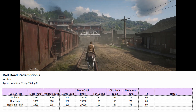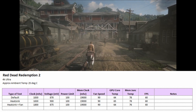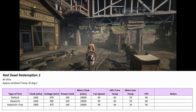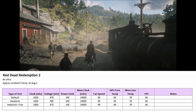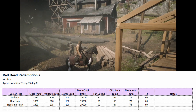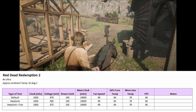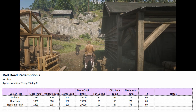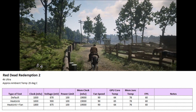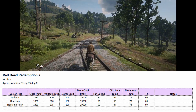For mining, I would say if you can find a faster fan higher than 2000 RPM, a better heat sink — maybe copper — and can possibly remove another 2 to 4 degrees, then that would start to look like a good solution. There's also the option of changing out the factory thermal pads and thermal paste, but ultimately it's up to you if you want to open up your card, which may or may not ruin your warranty depending on which country you purchased the card in. The results of doing that have also been varied — it's not always a given that changing them out nets you significantly better results. A good time to replace them would be when you notice temperatures deteriorating on your card.